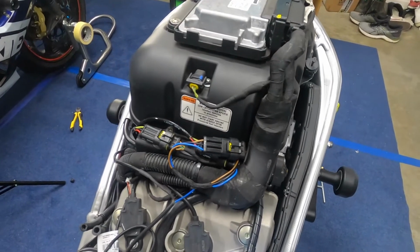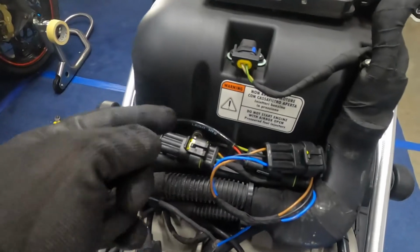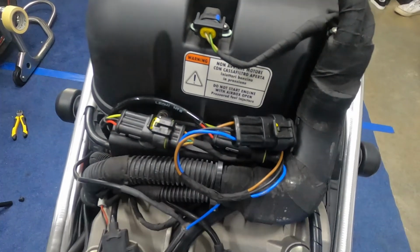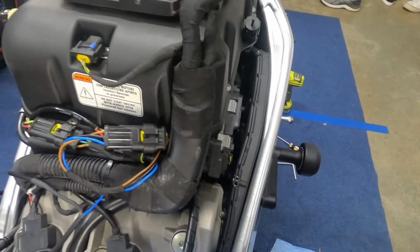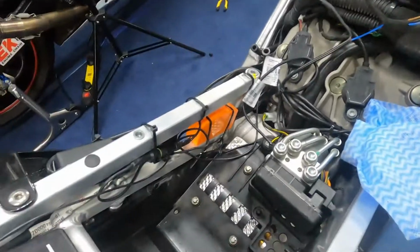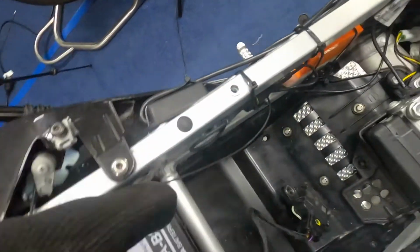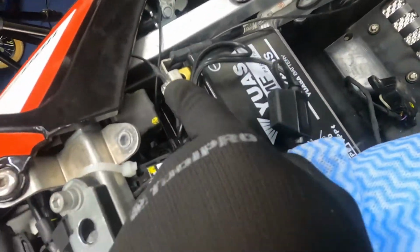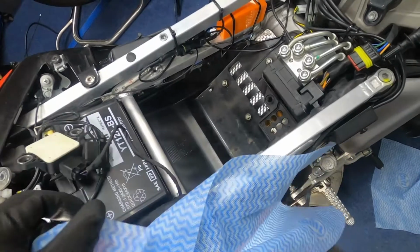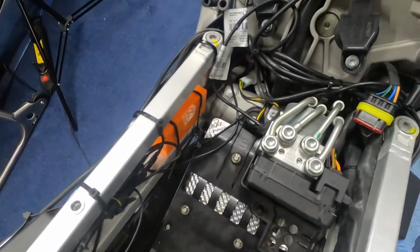Okay, just to be 100% sure, when you get the wiring harness, one of the harnesses goes into here. This is to power the module. There is a little black wire that goes to the battery. It goes from that left hand side, it goes into there, it's the negative. So I've plugged that directly into the battery. Some people just find the, what's it called, the ground.